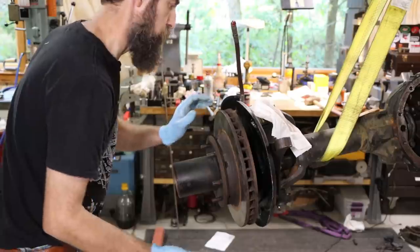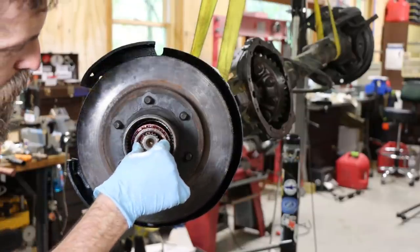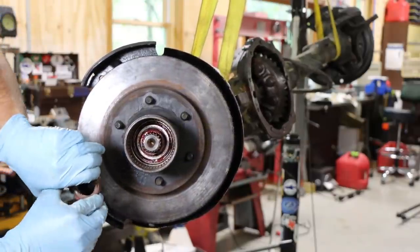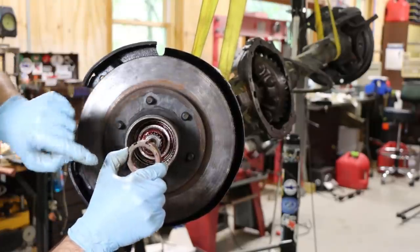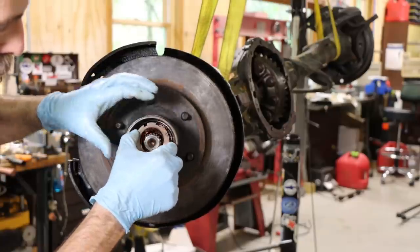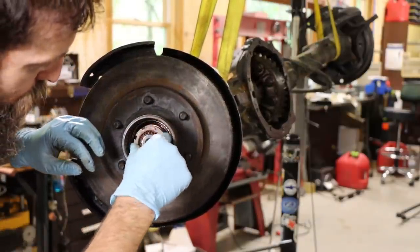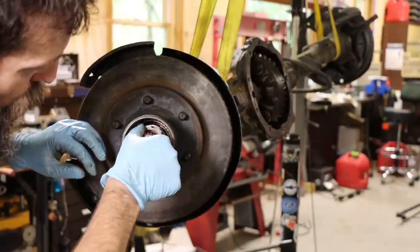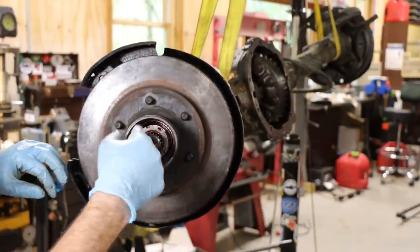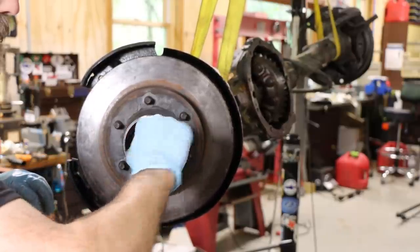It's gonna slide off of there. So front bearing. Then first retaining ring with a pin out. I don't know how many times I've seen those pins pushed in and not doing anything. Almost on every truck I've ever worked on. People get kind of aggravated when they're trying to set the bearing tension. I understand why. But.